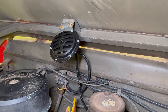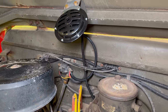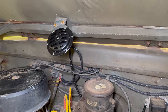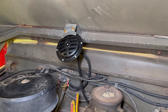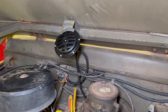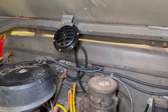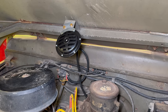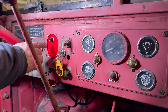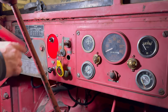The horn is hooked up now. I took a small wire that runs down to that starter solenoid — that is the power — so the longer wire running through the firewall and up to the dash is only supplying ground. This is a much more reliable way to do it: if anything hits the connectors on the back of the switch or that long wire gets cut somewhere, you do not have a positive feed that things can short out on. Let's hit it and see if it works. Horn button works — we're good to go.